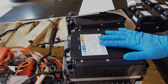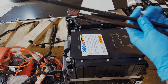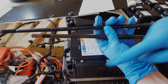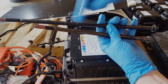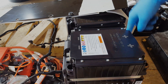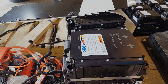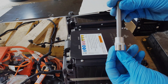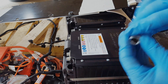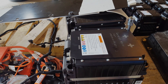One of these batteries is vertical on the very end where the BMS is. I took these two out and noticed that these bolts are shorter — these came out of this end — and all of the other bolts are longer. I looked in these two corners and there are some big Allen head bolts, so I'm going to take those out. I was trying to figure out why this wouldn't come loose, and it's because it's still bolted to the aluminum. It looks like the Allen head is a five-sixteenths — I'm sure it's metric — but the five-sixteenths fits in there and it's fairly snug, so I don't think it's going to strip out.